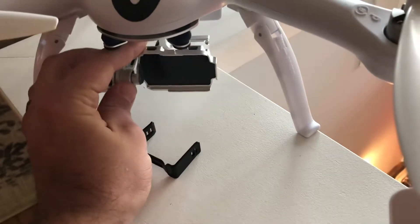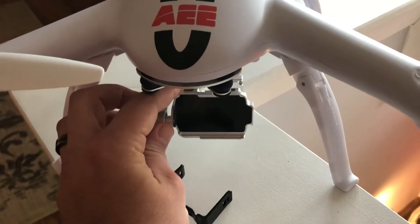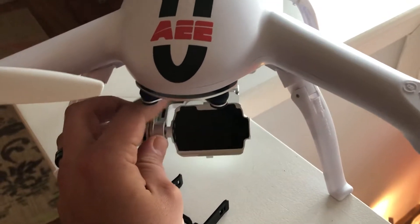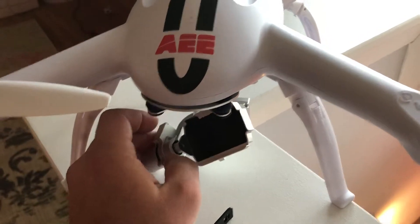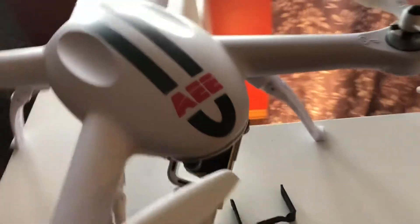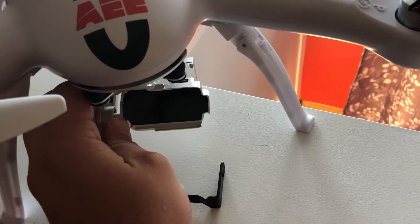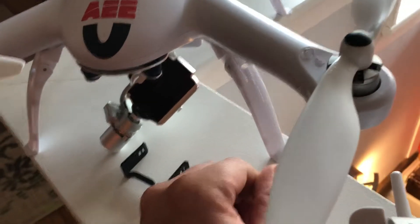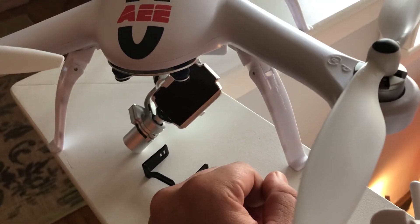The gimbal works very flawlessly and smoothly. You can control it with the remote using the camera pan-tilt toggle switch while you're flying — slowly bring the camera down, bring it back up. Especially on a windy day, if the drone is tilting back and forth, the gimbal will remain horizontal — the motors will move it to keep it level at the horizon for smoother video. If you turn abruptly, the camera will also correct itself via a motor that softens the turn. So if you turn left, it'll slowly level back up with the drone. The camera's not on there right now — I have it plugged into the computer uploading some footage I shot flying around town, which I'm going to post.